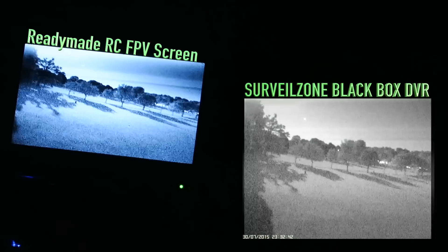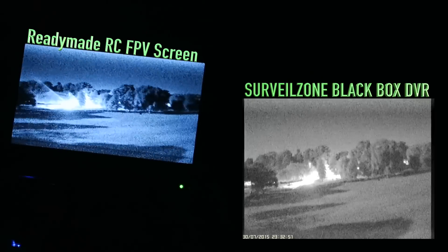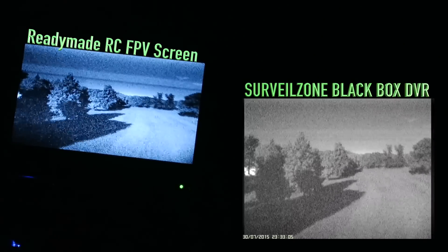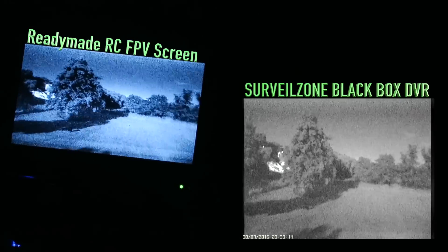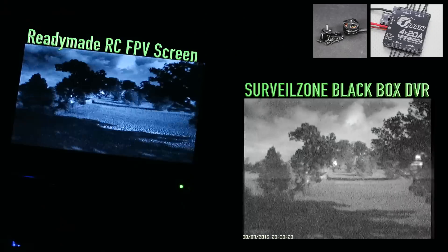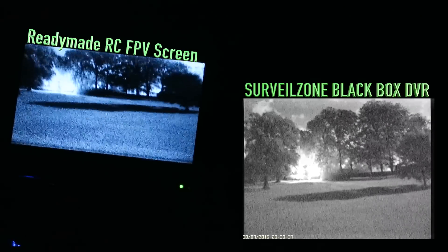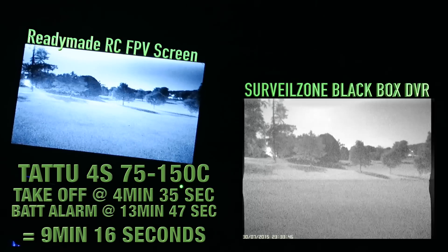Wondering whether some of the light frequencies that are out there are causing a bit of breakup. I guess the guy to ask would be Alex Greve from Video Aerial Systems, but he's not here - maybe I'll send him the video and ask him what he thinks. Really really nice though - this Racer X is flying superb. Really cheap little motors. I've got a Q Brain in this one, so it's an all-in-one ESC solution, very very easy to set up. Most people will prefer to have separate ESCs - that way if you pop one you've only got to change the one ESC - but I tried the Q Brain and I loved it.